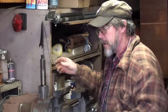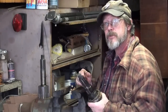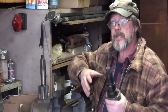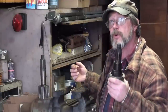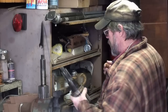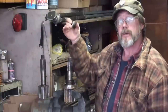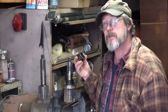When we started Project Whitey, there was a spare transfer case in there — a Spicer 24. We're working on a Spicer 23. The Spicer 24s were used in Ford trucks where the differential was on the driver's side, not the passenger's side, so they're actually the opposite of a 23. But everything inside is identical, with the exception of the gear ratios. I looked up a Spicer 23/24 online to see the exploded view, and sure enough, there's a spacer that's supposed to go behind the speedo drive gear, which was not in the transfer case when I took it apart.